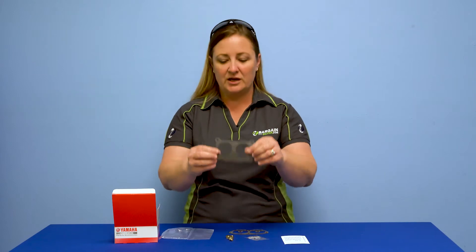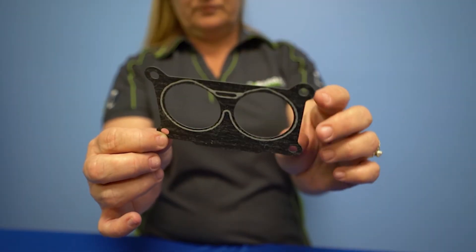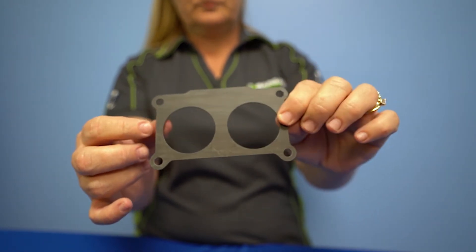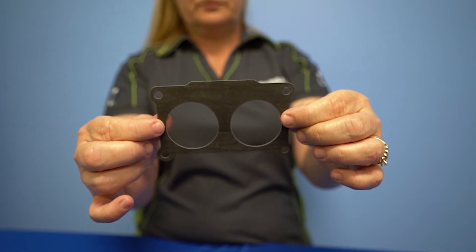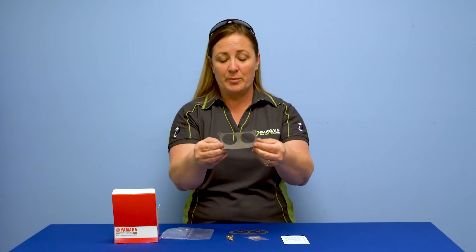First order of business: we've got a base gasket. Looks like it has a built-on sealant of some kind. I will point out that on our fuel gaskets, we don't ordinarily use a regular gasket compound. Some of them take Gasoila, and your service manual will tell you if it takes that or not. Don't just put a compound or a sealant on fuel gaskets — they don't always get it. You need to read up on that part.